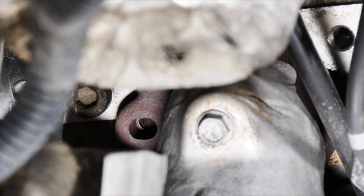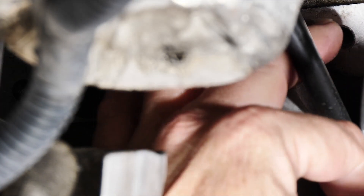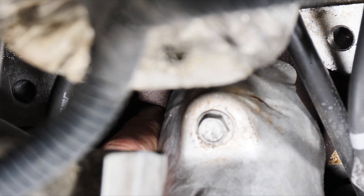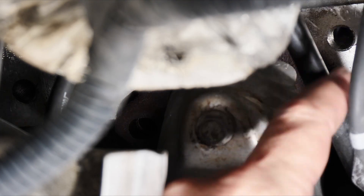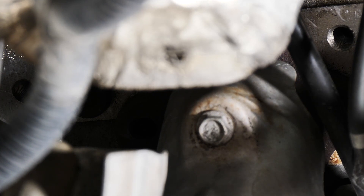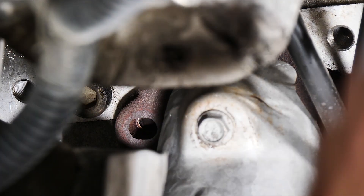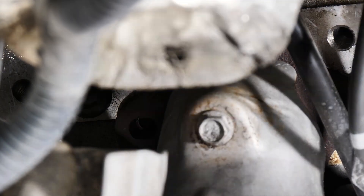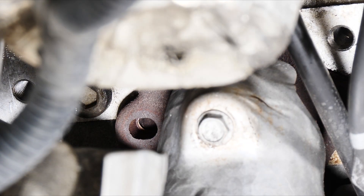What we have today is a part from Auto Parts Direct2U that is going to use this bolt and this rear bolt as a clamp to press in this back corner here. To get started, we're going to remove — this is the dipstick tube and it is directly in our path. We're going to remove this bolt and see if we can rotate it. It is kind of curved. If we need to, we'll remove it, but we just need to get enough room to get our bolt in right there. We'll fit up our clamp and get started.